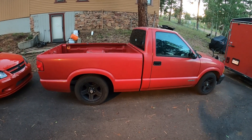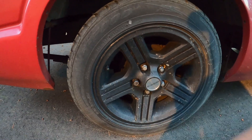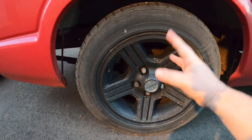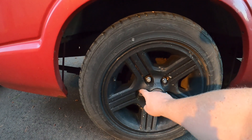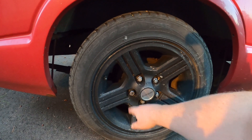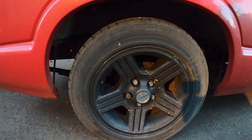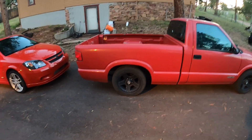So that first part is left off — obviously didn't really get anything completed, issue with the lug nuts, which are still the same case. Lost the key for this. I've had a few ideas since then — this was back in the spring. I had this issue on another vehicle a little while back and I was able to get a 12-point socket that I kind of hammered on and then I was able to take the lock lug nuts off. I might try that. The other thing I thought was maybe using a grinder — gotta be careful because of the wheel — maybe putting a notch in it and then trying to chisel it off. They do make better quality lug nut removal tools, so I could try that as well. Anyway, gotta figure that out — don't care if I destroy the lug nuts. Put the different wheels on and then try this wide body kit. Check out part two.